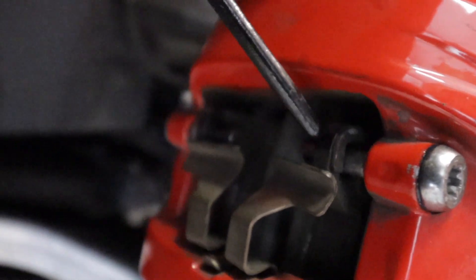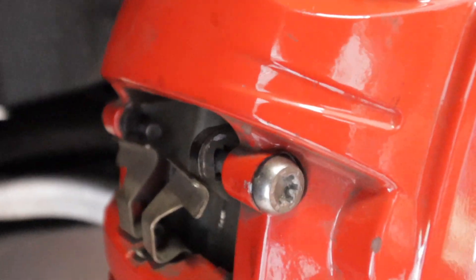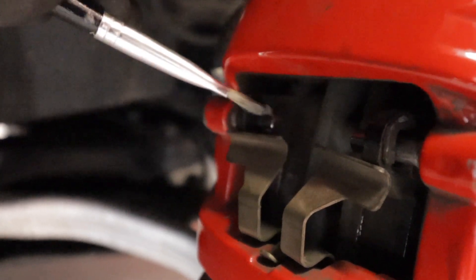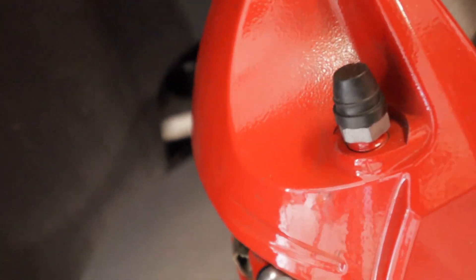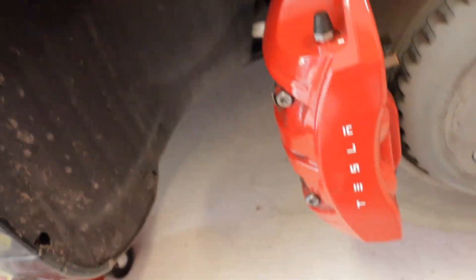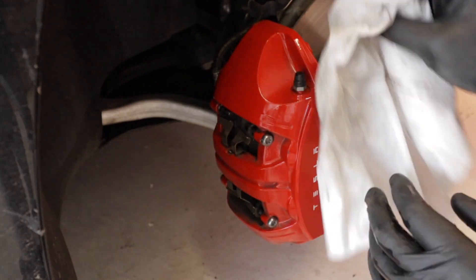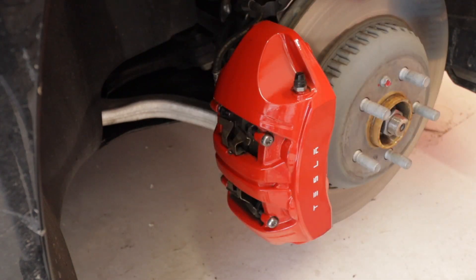Also on these pins, if you want to — I don't think it's necessary — you can add some silicone grease here for high temperatures. Just add a little bit of silicone on those pins. That's pretty much it, that's your brake lubing. When cleaning up just use rubbing alcohol, that's enough. Then you just take your wheel on and you're ready to do the back side or the other front side.